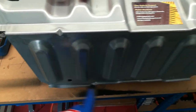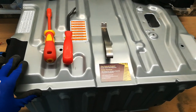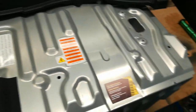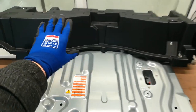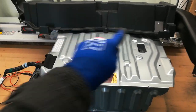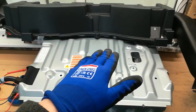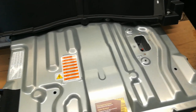There are two trim clips at the front that clip onto the inside, so lever those out. Once you've got all the bolts and securing parts off, you should be able to remove the cover without having to take out the massive side trims. You'll probably need somebody to help you lift and force this up a little bit. If it won't come out without removing another piece, you may have to do that, but it probably will come out with suitably subtle force.